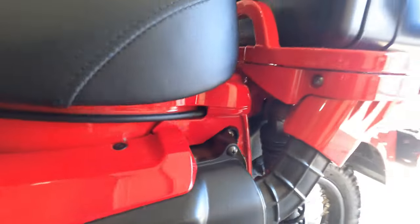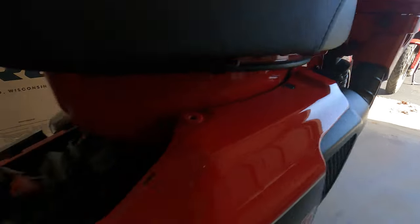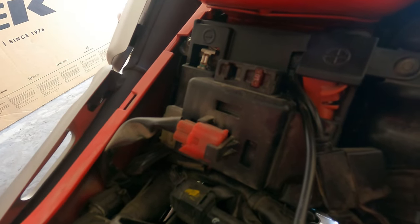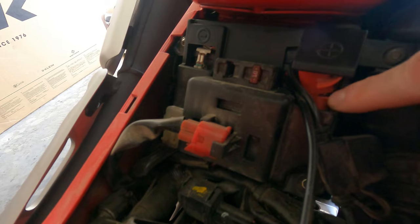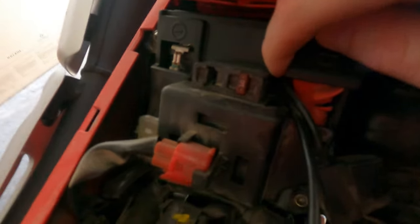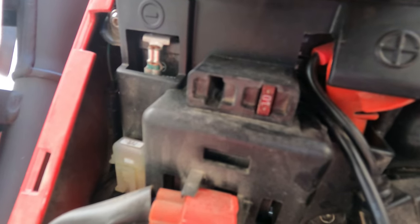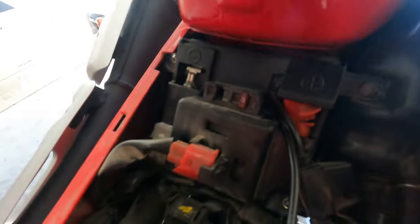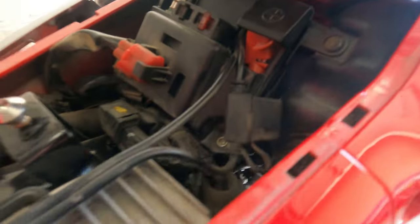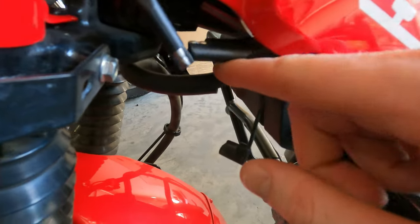Not that it's a bad routing — it actually works really well if you're going to drill a hole into your box on the back and charge your electronics off of there. But I actually opted to do something different. I made this hole bigger — I took a knife and made it a bit wider over here on this edge, so the wire has more room to run in and connect to both the positive and negative terminal through one side.